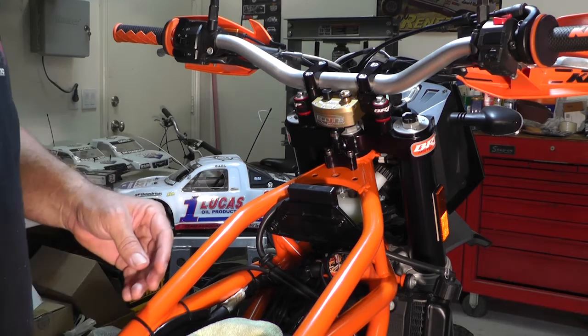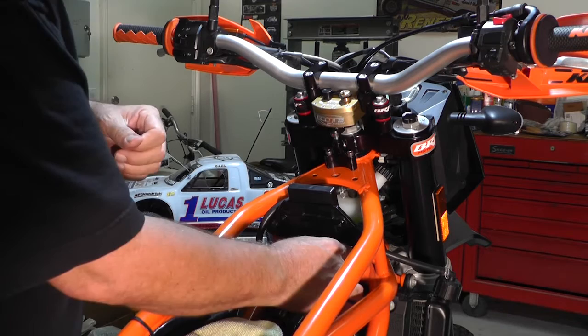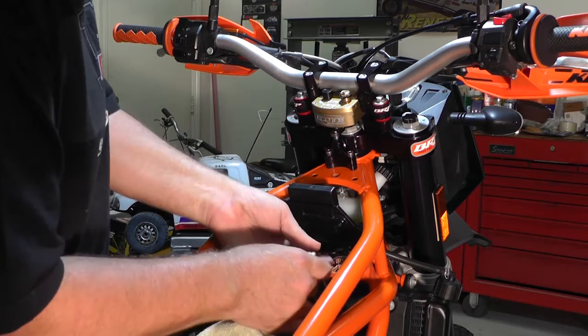The way you do this is you follow your throttle position sensor on the right side of your carburetor — the front carburetor — follow that wire. It happens to be located at the front of the ECM, right underneath the antifreeze expansion chamber. So you go ahead and gently pull that wire out to get to the connector.